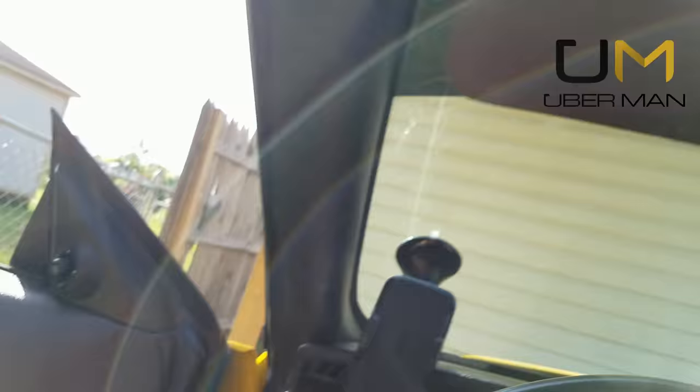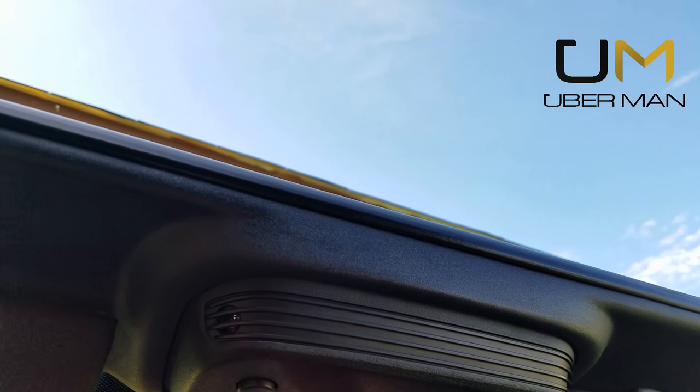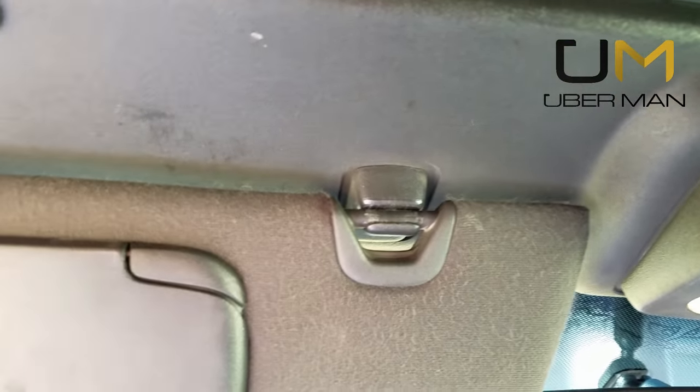All across the top you want all of these hinges lubricated, going all the way down. You've got more down in here — there's a hinge down there and what looks like a hydraulic pump way back in there. Take some WD-40 or something similar and keep all these hinges lubricated. That seemed to for the most part solve the whining issue I had with my convertible top. It still whines a little bit, which is normal, but before it was really bad — a really loud whine.